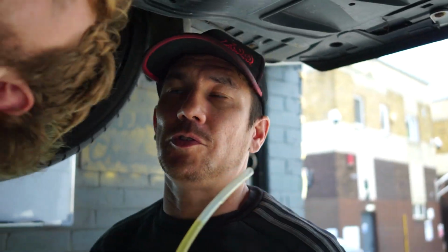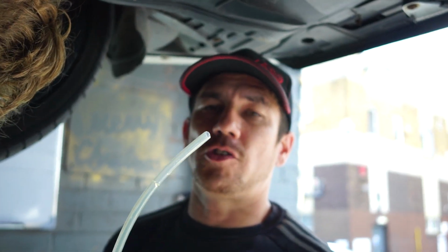However, just to make sure that we've got the right amount of Haldex oil or differential oil in there, we're going to just perform that second fill. So I'm not going to put very much in there because it probably won't take much. It'll probably be maybe 10-20 mil, but we'll just make sure that it's got enough oil, because too little is not enough for these.